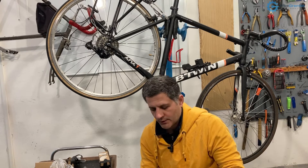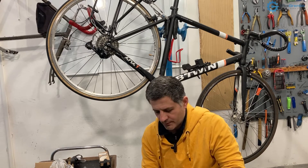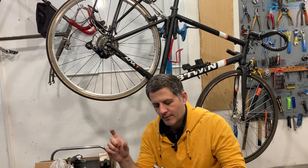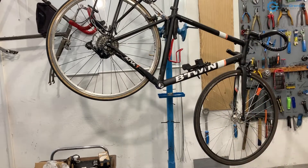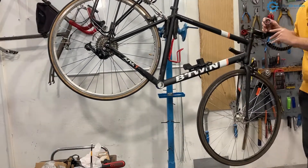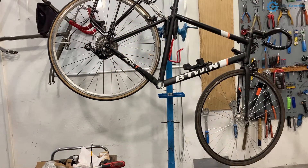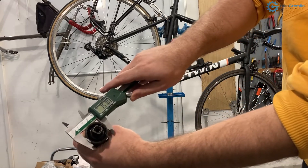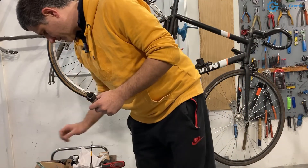I've already made videos about mounting bottom brackets. I will make a video timeline in the description with chapters, so you can skip to the parts of interest and not have to sit through a long, tedious video. Just double-checking before we do anything... Okay, I am stupid — officially. This is an Italian bottom bracket. The bracket is over 35 millimeters, so this one will not fit.